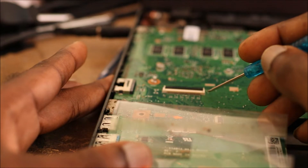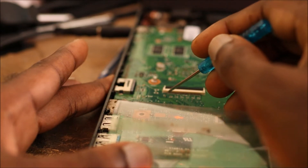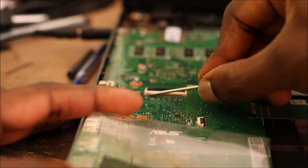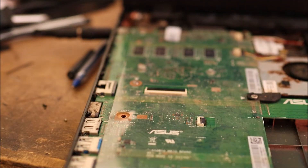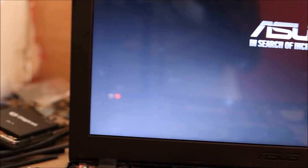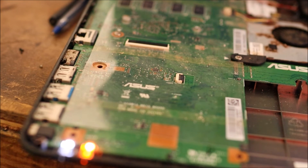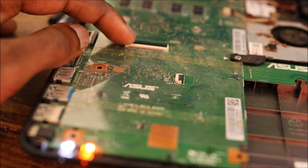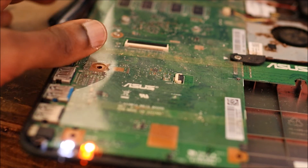You want to use the two pins at the end — normally on this side. So let's try the first two pins on this side. As you can see, the laptop is coming on! So definitely it's the two first pins on your keyboard connector — short those two pins together and you will get your laptop on.